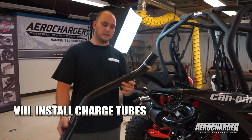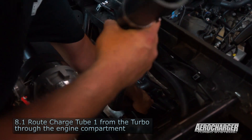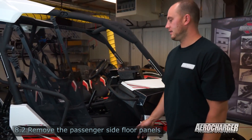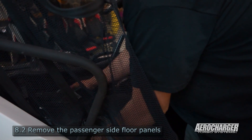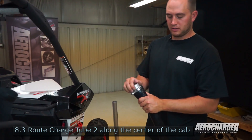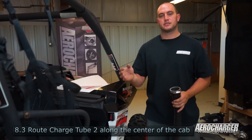Now we're going to start mounting the charge tubes to the front of the vehicle from the turbo. Start with this guy — it goes in there like this; you want it to go down between the frame brackets. Now we're going to be moving back up to the front of the machine to remove these panels — I've already removed the push pins, so I'm just going to pull them out. Pull out the floor panel; it's got a few screws and push pins holding it in. Now that we have that clear, we're going to grab this charge tube out of the kit. You'll notice it has a small aluminum tube in it already — that's for the two-seater kit. On the four-seater, take that out and set it to the side; we'll install it later. For now, take this and route it back to meet up with the charge tube we just ran from the turbo.